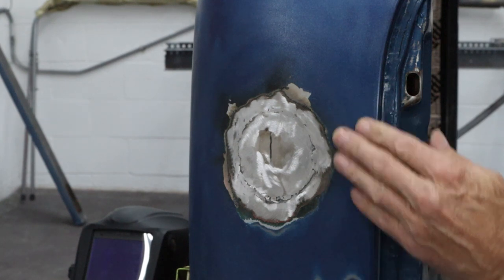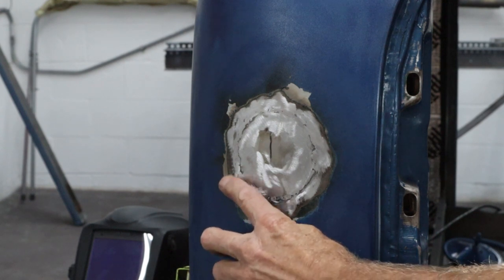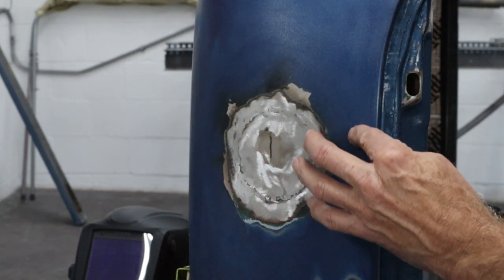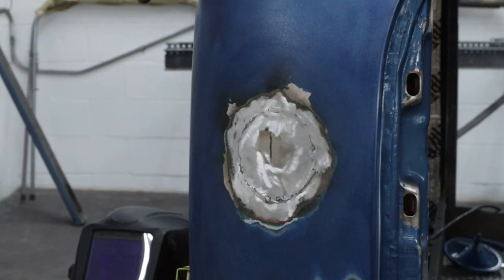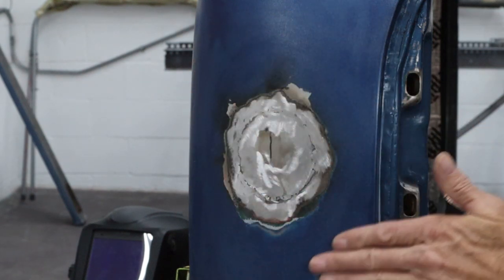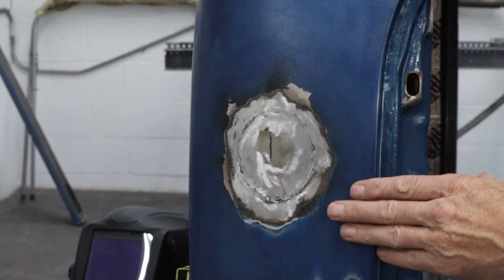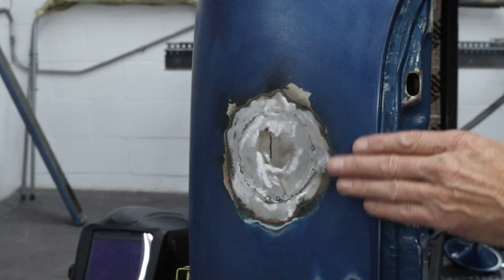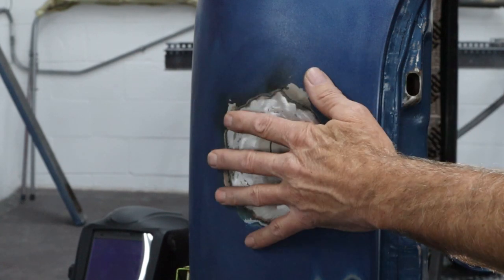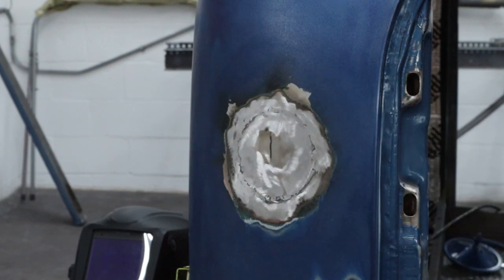Next step - there's a little low spot right here I just tapped out with a dolly, so we're going to have to grind back here. I found a little body filler right in here, so we'll grind it back a little bit all the way up to here, then we'll get some body filler on this and get it roughed out. First I want to scuff this whole area so when the body filler goes past, it sticks. The owner had already sanded the whole cab with some 320, so I'll rough this out with about 80 grit. I roughed it up around the exterior, hammered and dollied it out more once I got that lip on the backside ground off. Hit it with some 36 grit on my big sander and removed the paint back until it was nice and sound. Ready to be filled.